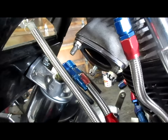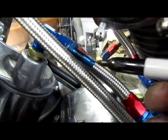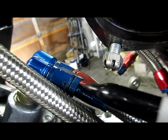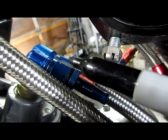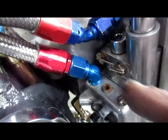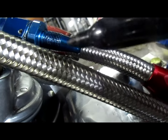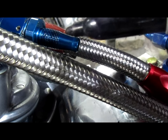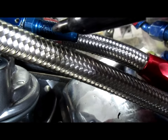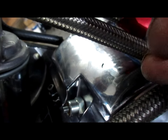You need to do a little bit of planning. You could spend a fortune on special tools to do these, or you can do it this way — it's not that hard. I'm going to take a felt pen. Here's my fitting, screwed in tight where it's going to end up, and the other end of the hose on the other end of the fitting. I'm going to mark the hose — the hose will only come to this part of the fitting; it won't go over the threads. So mark the hose just about there.